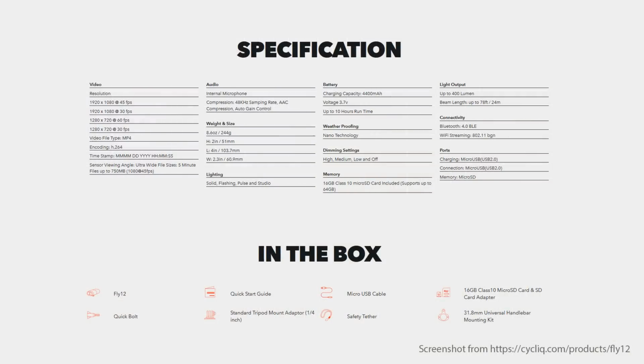Alright, you can see here basically we've got 1920 by 1080 or 1080p and 1280 by 720, which is 720p. The various frame rates there. You need the app to change that. It's MP4 with H.264 encoding, which is pretty standard stuff these days. The actual viewing angle, it doesn't say what it is. I'm not sure. It's got a bit of a fisheye lens effect, but it's still very viewable. It's got a good spread, which is what you need.